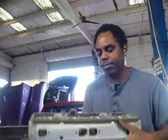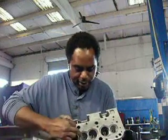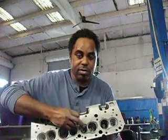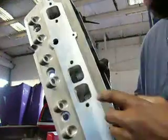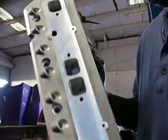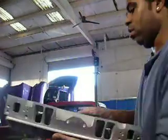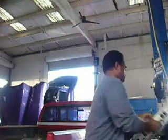CJ with ART again. We're porting some heads — Pro-Comp cylinder heads. These are 202 intake and 160 exhaust valves, stainless steel. And we're going in here and smoothing down the casting marks in the cylinder head, as you can see. These are 64cc combustion chamber cylinders.